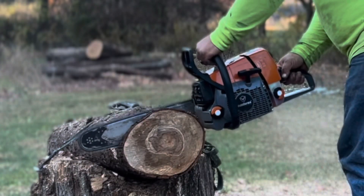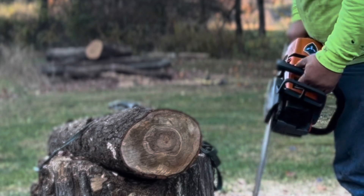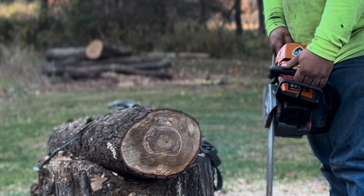10% nitromethane seems to be the limit of what I can flow. The carburetor is definitely going to need to be modified — with my jets cranked all the way, it was still a little on the lean side. It's quite a bit of a difference though. I really picked up some torque — she's producing as much torque as a lot of my normal ported saws, and this thing didn't have a whole lot of torque before. That was a significant increase. We're definitely going to have to modify the carburetor more to get her up to closer to 40% — a considerable amount more flow.